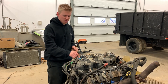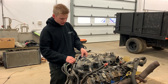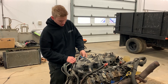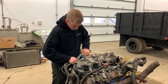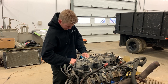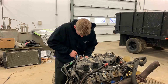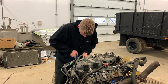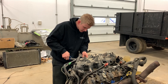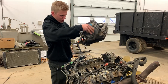Alright, so we're going to take this intake off and we're going to put a 6-liter intake back on. We have it unbolted. I got my fuel line tool to take these fuel lines off quick. Push it forward, push the tool in, pull it like that. It's supposed to be easier than that. Ta da. And intake's unbolted. Out she comes.